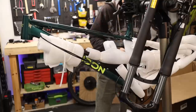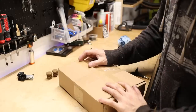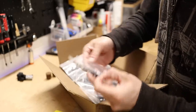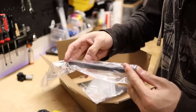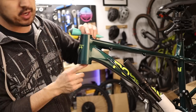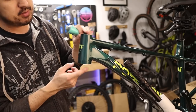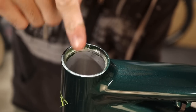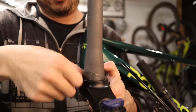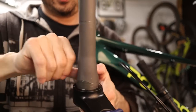At this point we can start getting rid of the rest of the packaging on the bike. In the small parts box you will find the front and rear disc rotors, disc rotor mounting bolts, a pair of plastic test ride pedals, the rear through axle, and the headset bits. Before we install the headset we want to grease the integrated headset cups in the head tube — you don't need a ton of grease, but get a thin coat on the entire metal surface. It's also a good idea to get a thin layer of grease right on the crown where the race is going to sit.